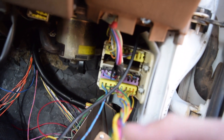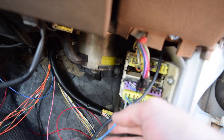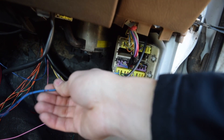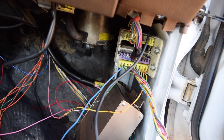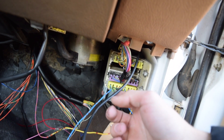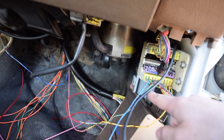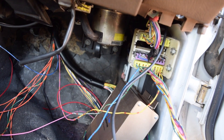A lot of these wires we actually don't use. One of them is AC, so we'll figure that out. Over on the left side, this top blue wire is our tachometer signal — it goes from the ECU to the dash. But we need to bump it up to about 100 volts, so we have an external device for that. Going over one and down one, there's a green wire with a white stripe — this is a switched 12 volt power, and this is what we use to power the ECU. The red power wire on the gray connector goes straight into this green wire, so whenever you turn the key on it powers up the ECU.